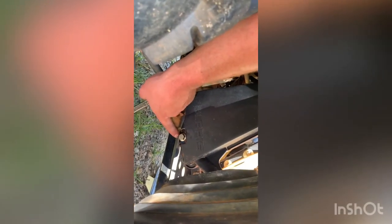Last time I saw one on the internet it was about $140, so definitely want to be careful — it's a metal insert into plastic, so you don't want to over-tighten it for sure. It's probably a good idea to change the gaskets on these; I'm going to change the oil again pretty soon just to be safe. Snug it down — good snug, not too tight.